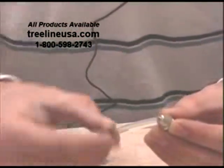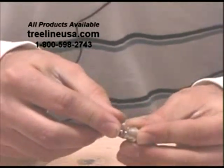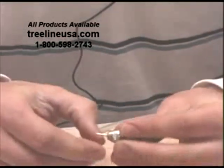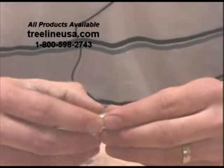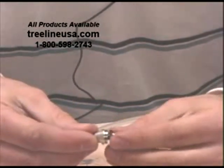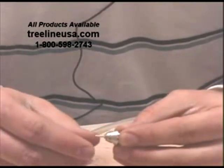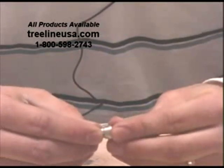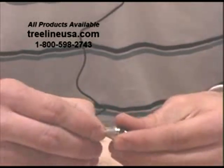Next, take the square end of your other wrench, put it over the bit, and turn to loosen the chuck nut. Then by hand, I'll hold onto the end and spin this. Sometimes when you're doing that it gets really stiff, but make sure you're holding onto these black fans securely to be able to rotate that chuck nut out. Sometimes you might have to put a pair of leather gloves on to get this loosened up. Normally after the first time, you don't need to worry about that.